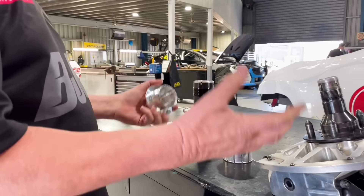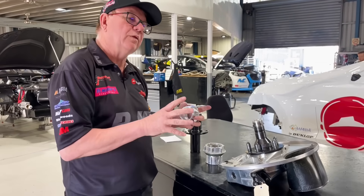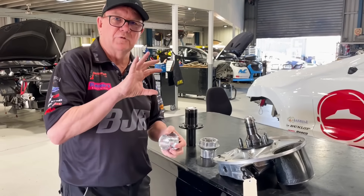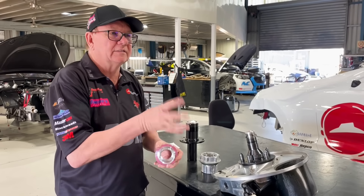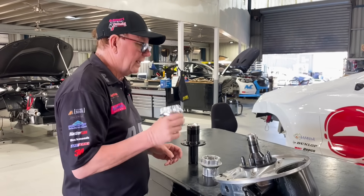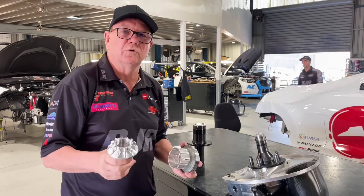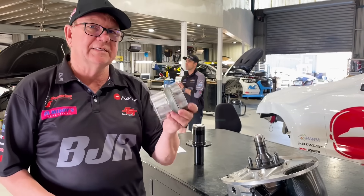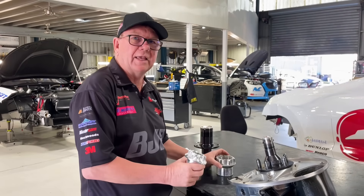What we do now is run the same pressure, same rattle guns, and the guys know when the wheels are tight in a pit stop through the hammer hitting. When it spins, it winds on, and then it starts to clunk when it feels like the wheel nut is tight. One hit of the hammer with this is around 350 pounds of torque. One hit of the hammer with this is 800. So this instantly does up a lot tighter than what we currently have.